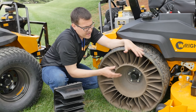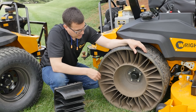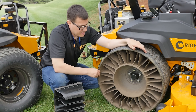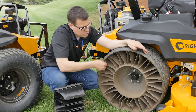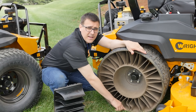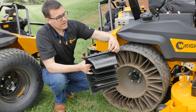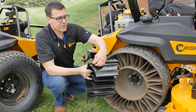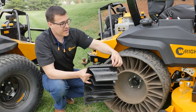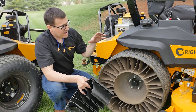They're designed to relax. The spokes on the side are under tension, keeping the wheel from becoming elliptical. The outer band is under compression the entire time — a controlled amount of compression and relaxation. You can see it flattens out on the bottom just a little bit, which is ideal. In the cutaway, there are cords all through the intersection of the tread in that band, giving it the appropriate amount of stiffness, and then there's tread rubber on the outside. That's the basics of what makes up a tweel.